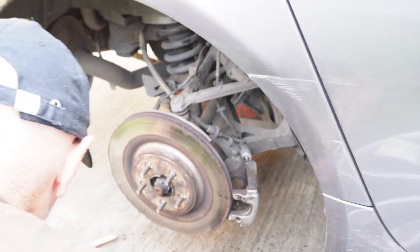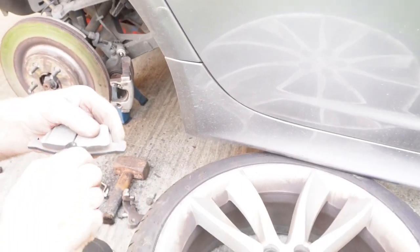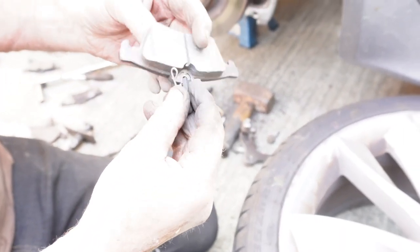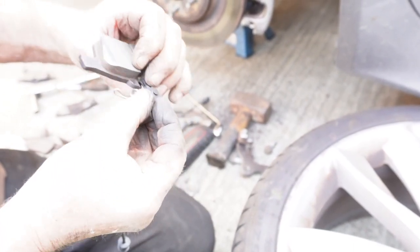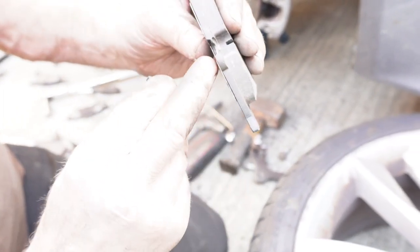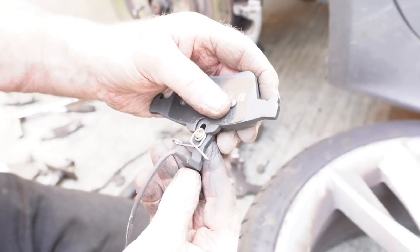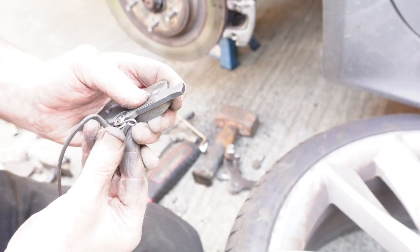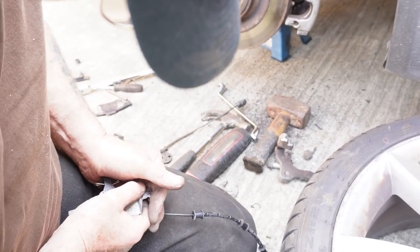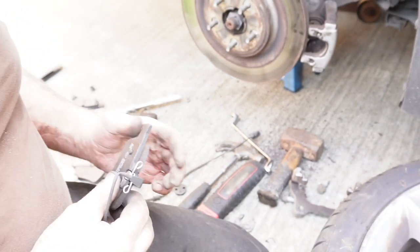When you're replacing your wear sensor, remember which way it goes — it goes in that way pointing outwards. What you do is you take your spring out like that, you press your wear sensor into your spring, and then this little lip here goes in between the coils of the spring. Then you press it in like so — then that is in. That's exactly the same as the old one.